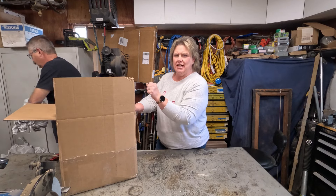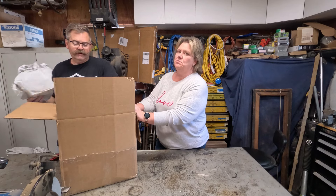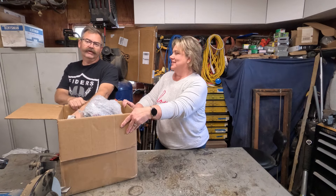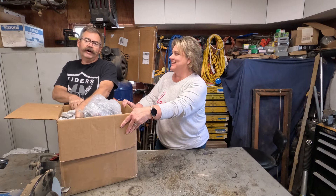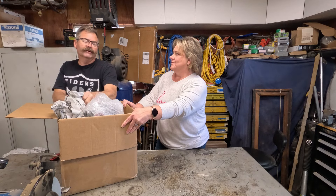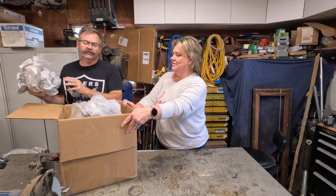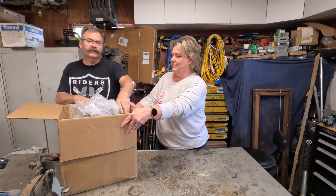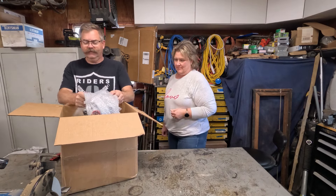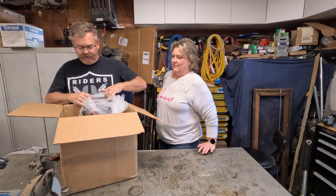On the two-door, it was making a clicking sound. Once we got the new one back rebuilt, it's been awesome because we've really abused it. A little tech tip: the clicking sound was the four-wheel drive popping in and out, which is more common on the '99s, at least that's what I've been told. When they rebuilt it, they put in new seals, a rebuild kit, and the three-to-one Trail Creeper gear set, which I really liked.